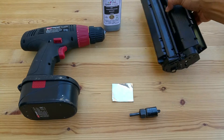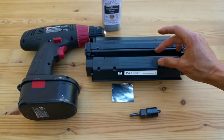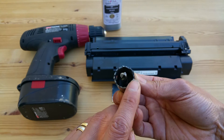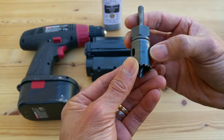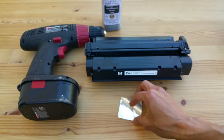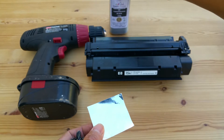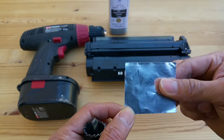So this time I'm going to drill a hole. This is the front — it will be right here. You will need a drill bit, which will make a hole right here, about 7 to 8mm. And once I drill the hole and refill the ink — make sure you buy the USA one — I'm going to patch the hole with this aluminum tape that comes with the refill ink.